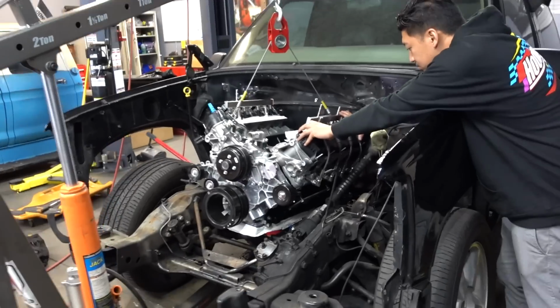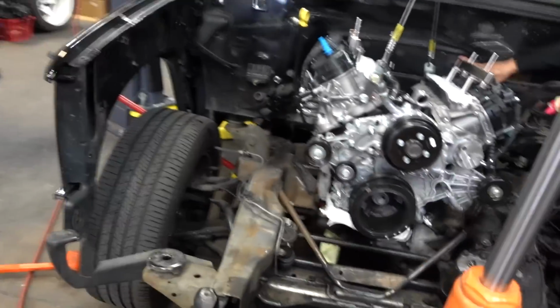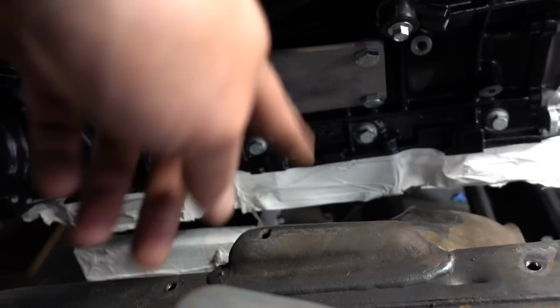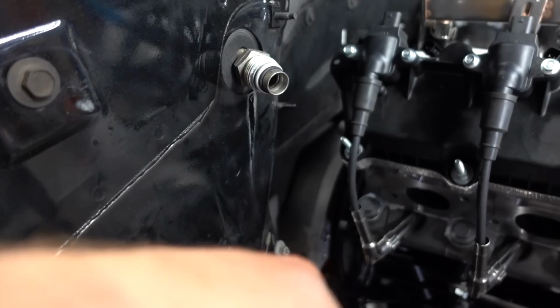All right. So we have lowered the engine in for a final test fit here, and look at that. I probably need to bottom shop it. It clears the diff, which is good, and it actually allows it to sit more where it's supposed to be, because originally we had this thing so far back that we were gonna have to make some crazy mount setup, right? But now, because we can bring it forward more, the mounts damn near line up perfectly with the original one. So this is gonna work out. We can use the original pads. We can move the trans forward, and actually we'll be able to access the bolts without doing some ridiculous cutting of the firewall, so that's good. But I think we're good to go.